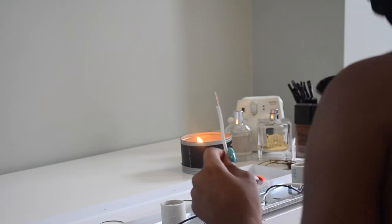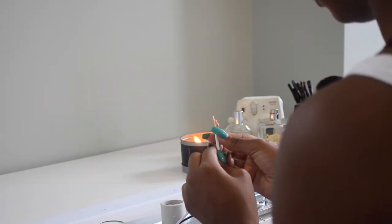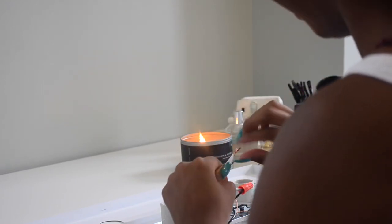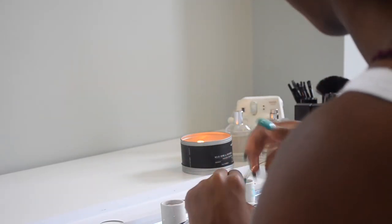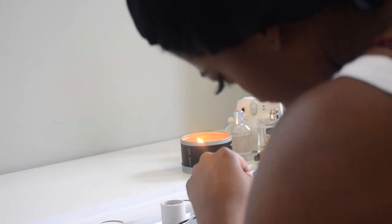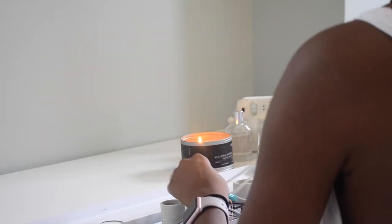So you're going to do the same process with the other side of the extension cord and connect it to the white cord. And you're just going to twist them together just like this. Make sure you twist them together really good. And then you're going to cover this again with another wire cap. The wire caps that I got were pretty small, and the ones that came with the light fixtures were too big. So make sure you get the right size wire caps. I'm going to put the sizes that I got in the description box.